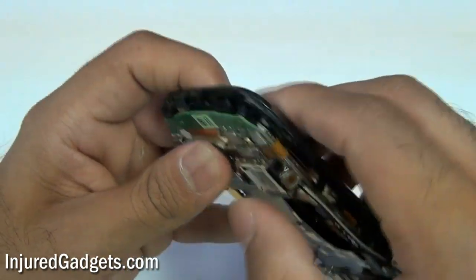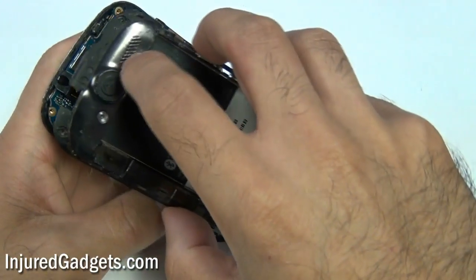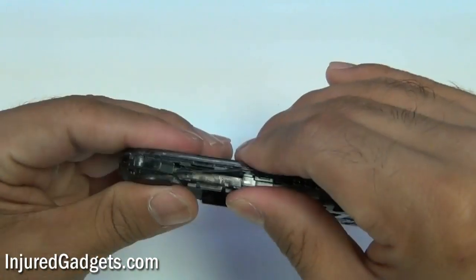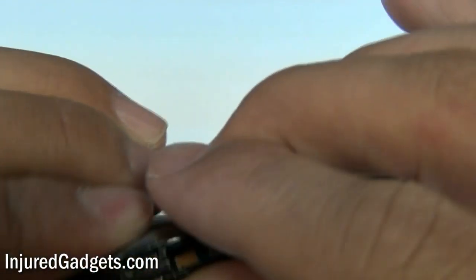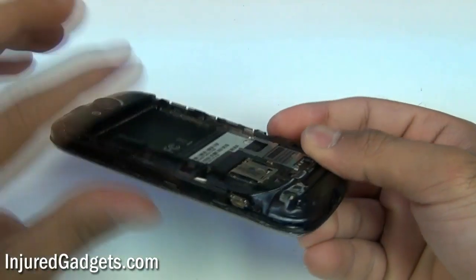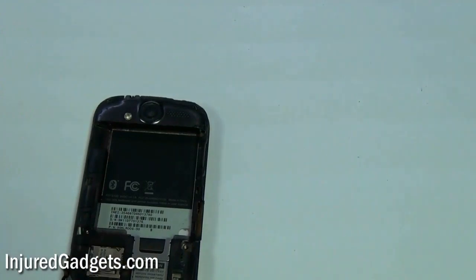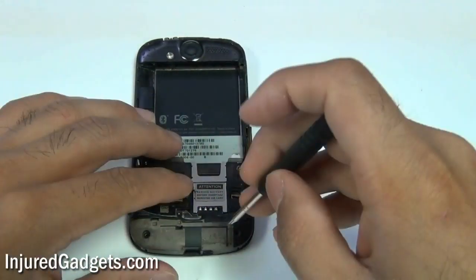Go ahead and do the bottom screws — I always like to do the top first because of those little clips. Now take that plastic back housing and put it on, making sure those two side cables on the top as well as the bottom cable are outside of the back housing, not inside it. Push those cables in, make sure they're sitting flat, and clip the back housing in properly, nicely and tight. Make sure it's flush on all sides. Once you've ensured it's all clipped in, go ahead and put that little plastic plate on the bottom back on, screw it in with the two screws as well as those two top screws.